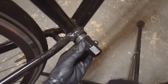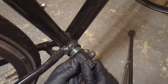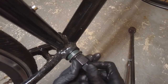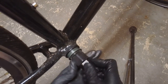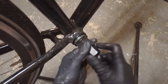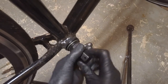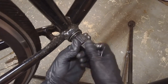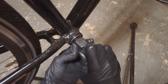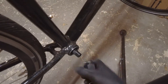Turn it counterclockwise on the drive side. Just take your time — you don't want to be stripping any of the threads. If you strip the threads, you're screwed; you're going to have to buy a new bike frame. So we're just getting it on here with finger strength. The reason I was having a knocking noise on this bike was this was not tight enough. Now I can't go any further with my fingers, so I'm going to use a tool.